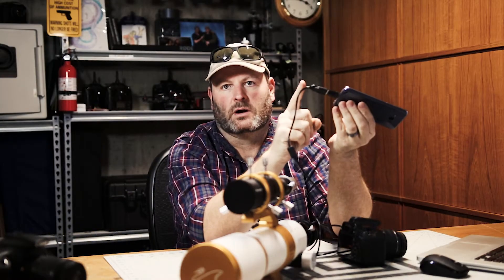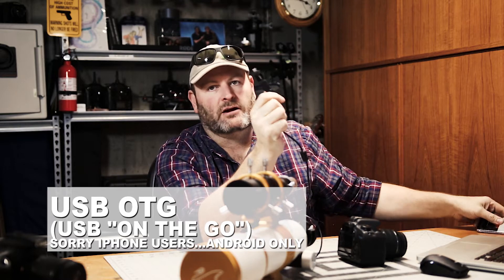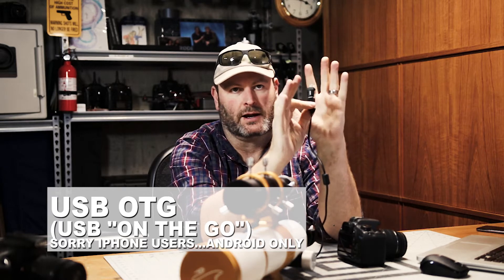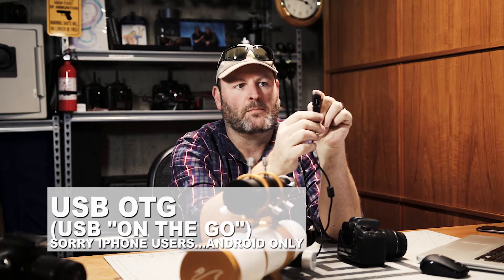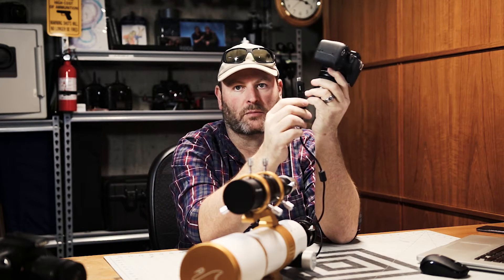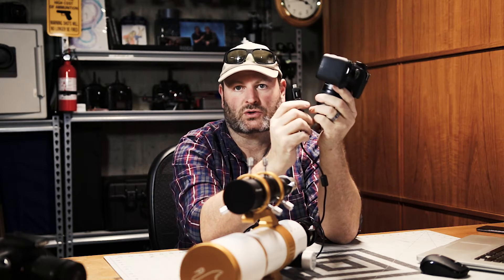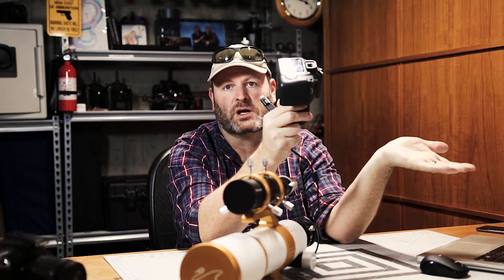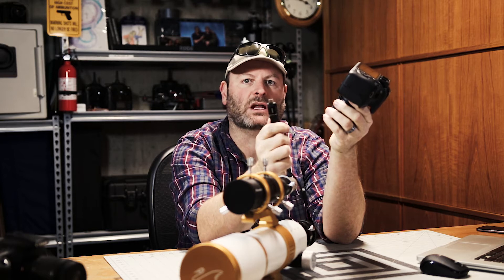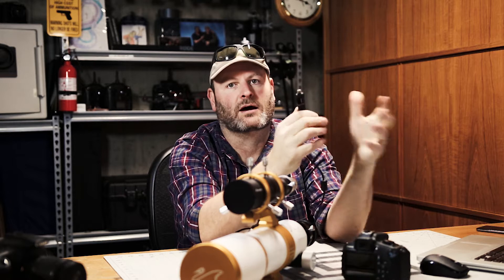You have to make sure that you buy what's called a USB OTG connector — that's very important. This is not just a gender-changing device. It actually has some circuitry in there that makes it so your phone can decode the signal coming from your camera. Your camera's USB port is usually used to transmit information to a computer. Without this USB OTG connection, your camera is going to send information which your phone cannot decode.